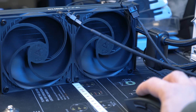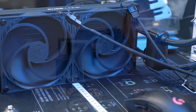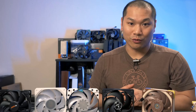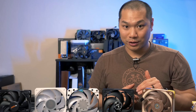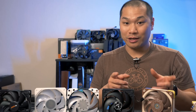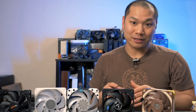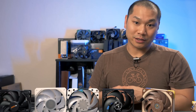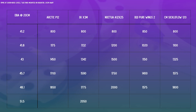The test was done on an open air 240 millimeter Pure Loop AIO. The Ryzen 7 3700X was locked at 4.3 GHz for all cores and 1.25 volts, which consumes 90 watts during the Blender render — a healthy, consistent real-world thermal load. Temps measured are the average of the final minute of CPU temps. Fan speeds were locked with a Corsair fan controller, with the two fans on a 240 millimeter radiator on separate channels so RPM can be precisely specified. Results are adjusted to reflect an ambient room temp of 25 degrees C, a middle ground between a cooler 20 degree room and warmer climates.